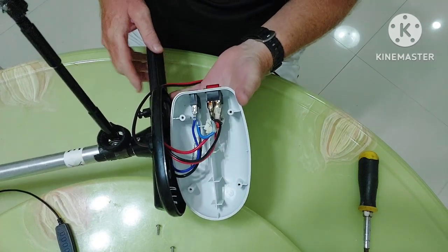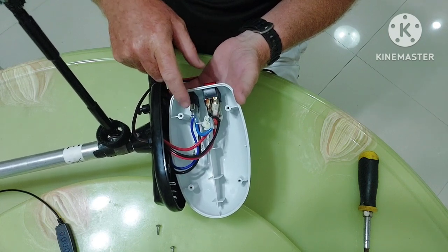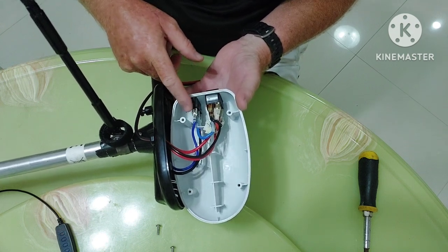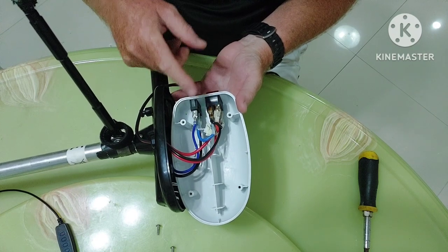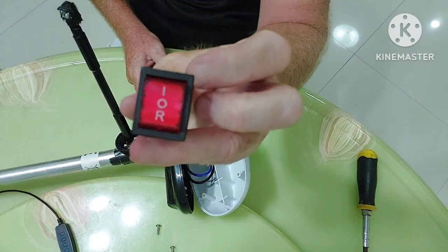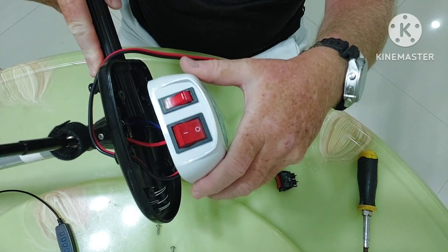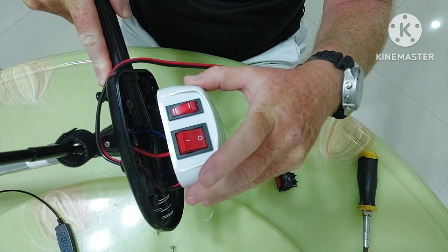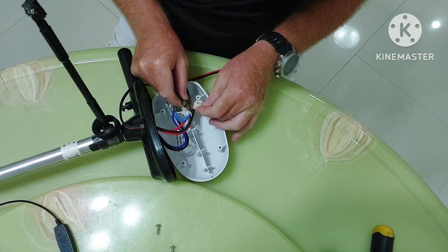As you can see, these wires here go to the three-way switch for forward, reverse, and neutral. And this is the switch for high and low speed. The high/low speed switch looks fine — I'm not going to touch that one. The problem was with the other switch. Remember, this is the original switch right here — I bought a substitute locally because this is all they had: just forward or reverse. I need to take that out and put in the proper switch, which is labeled number one.